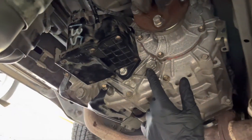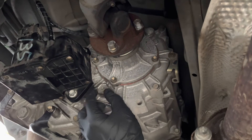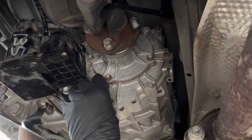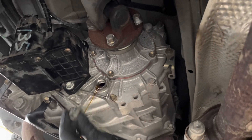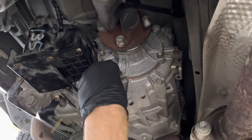Here's our fill — as we saw before, this is a 24mm plug. I just loosened it with a wrench. They're both 24s — those are all the diff plugs. It's over the fill hole, so we're full.